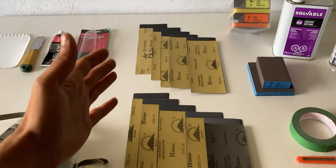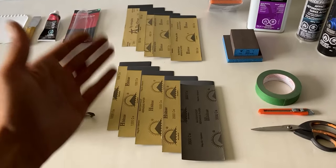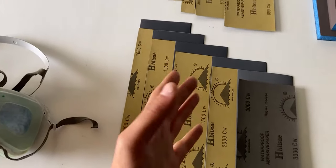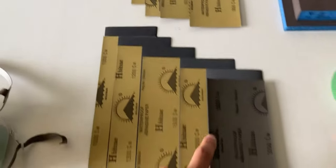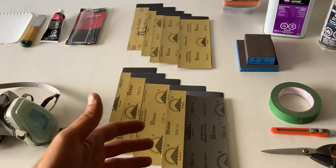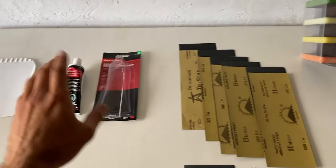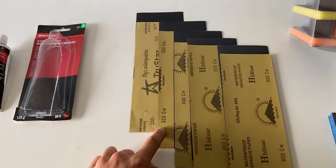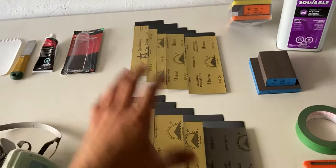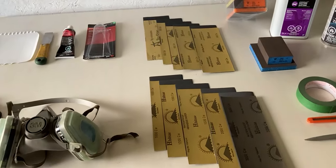Further to the right I also have a bundle of sandpaper. This was one kit on Amazon — super cheap but pretty good quality. You can use it dry or wet, and the grit runs from 220 all the way up to 3000 with around four or five sheets of every grit. If you want to sand down the glazing and spot putty, you'll be running something around 320 or 400 — you don't need anything smoother than that because the primer will fill in some of those smaller blemishes.